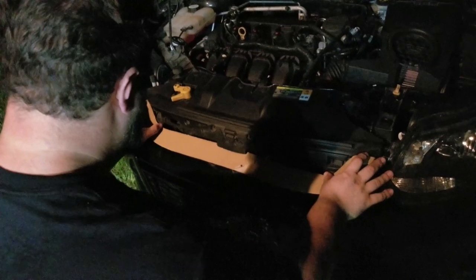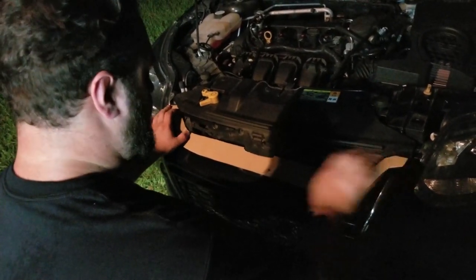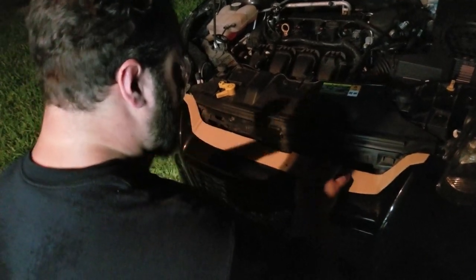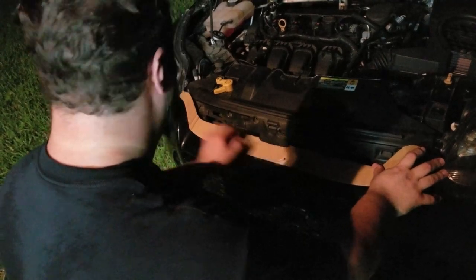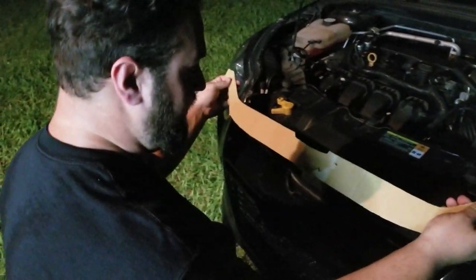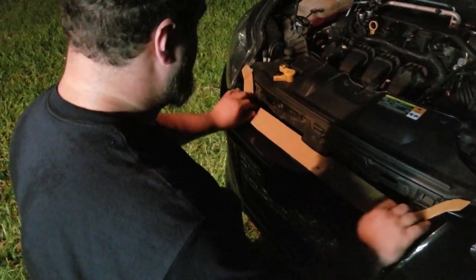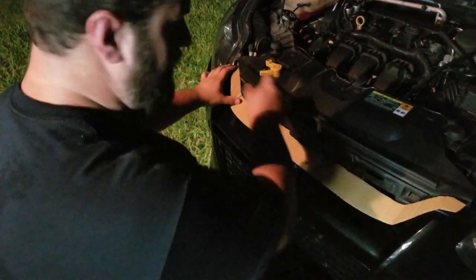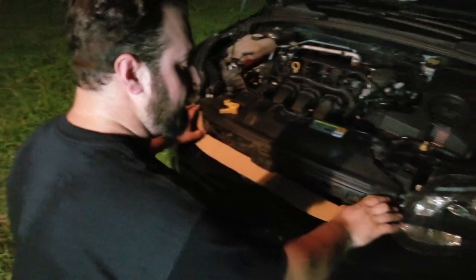Alright, so what I did was I took a cardstock strip, traced that into the general idea, and then transferred it to the cardboard — which is kind of the same width — and then tested it out like this. I actually added a half an inch to the center which, as you can see, worked out perfectly and looks really good. Next step is to transfer this to the ABS sheet. From that, I'll cut out the ABS, heat it up, and place it down to mold it — just keep the heat on it, let it sit, tape it, and it'll harden into that shape. It's kind of the same idea as the new edge Mustang Mach 1 grill delete.